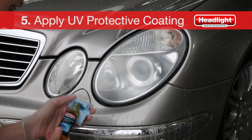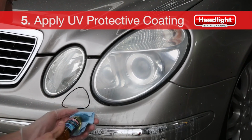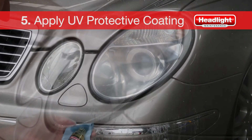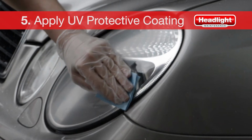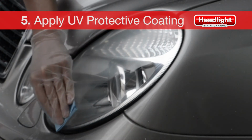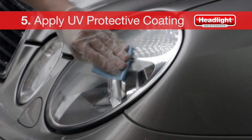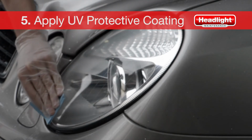The fifth and final step is to apply the UV clear coat. With a protective glove on, to prevent the UV clear coat making contact with your skin, saturate one edge of the blue application cloth. For best results, apply a generous amount of UV clear coat and carefully wipe it onto the lens in long even strokes. Make sure you keep the edge of the cloth saturated as you coat the lens.